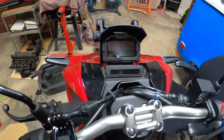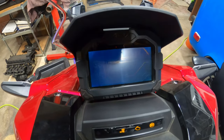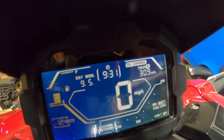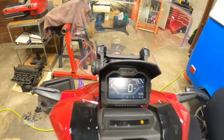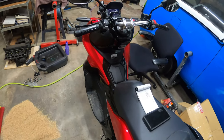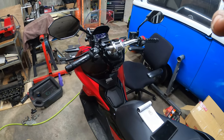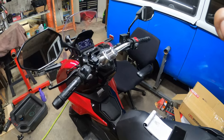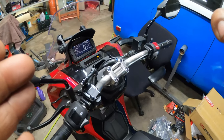What you're going to need to do is make sure your lights are on. You're going to see here the oil change light — that means you just hit your first 600 miles. I just actually hit my first 600 miles on my scooter today, so the light just kicked on. I just did a fresh oil change and now we're going to do the reset.